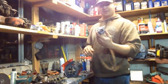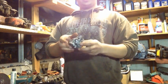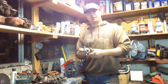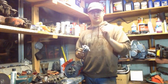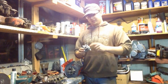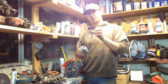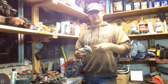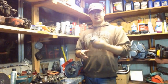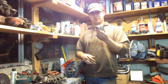I got the carburetor kitted. I got some kits on eBay, which is pretty cool, and they're full kits. They come with the needle and the seat. It converts the needle and seat — it's a brass seat with a rubber tip on the needle, versus the old one which had a rubber seat and a metal tip on the needle. It also converts it to the type where the diaphragm slides into the metering lever and actually holds the metering lever. I soda blasted the carburetor out really good, cleaned it out with brake cleaner, sonic tanked it, and put new diaphragms and everything in there. This carburetor was also off the 775, so this one should work pretty well.